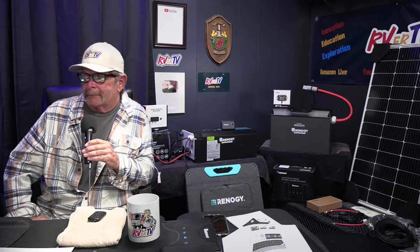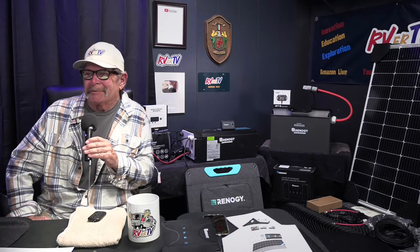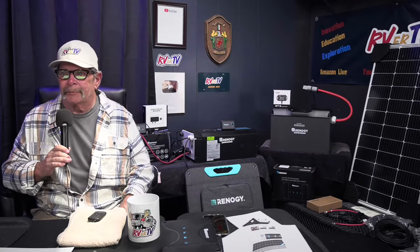Tom Hobotech wrote: I couldn't fit the 3,000 watt under the seat, that's why I got the 2,000 — and I didn't want the higher background power use. That's a good point, Tom. These inverters do draw power even when shut off; there's a background draw on the battery. But if you have enough batteries, it doesn't matter.